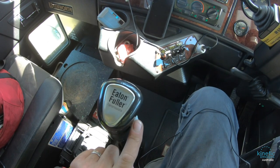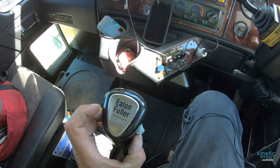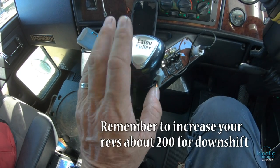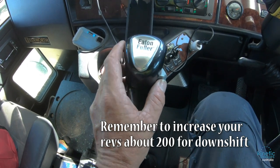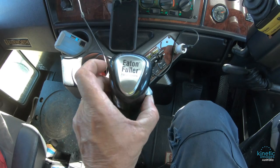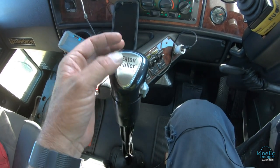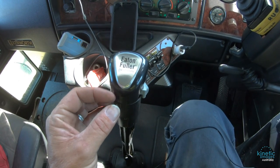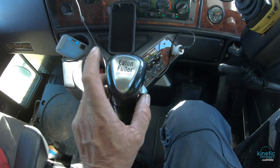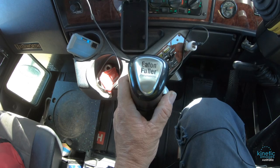If I wanted to change a whole gear in the split position, which is forward, that's easy. If I want to downshift in this gear, I'd go straight back in. If I wanted to upshift, straight back in. It's a case of when I pull this gear lever into neutral, apply the clutch and put it in gear — I've taken the load off the gearbox, which allows the splitter to make its mesh and it changes nice and smoothly.